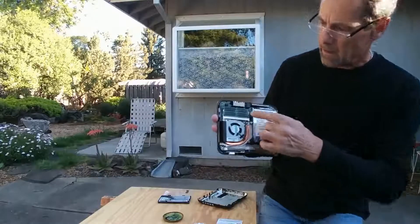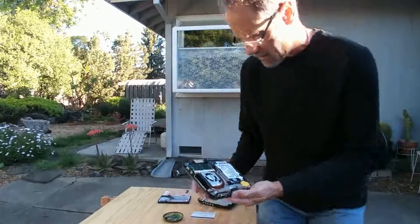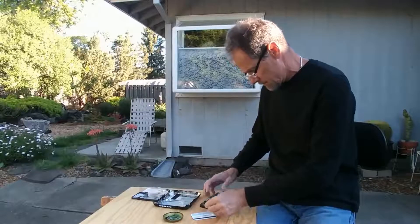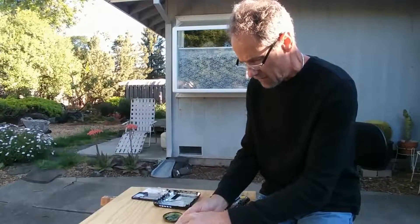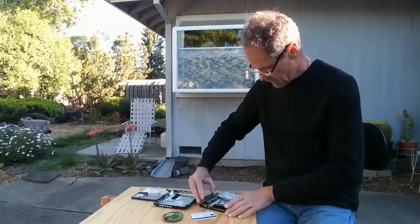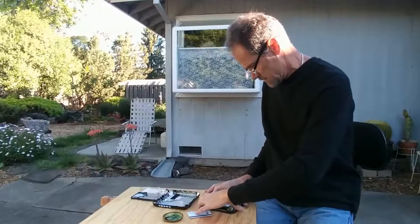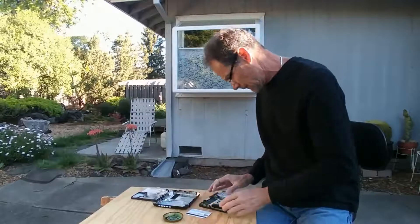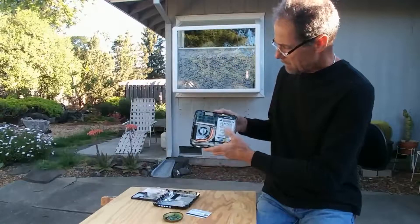And there's the card I'm going to replace, right there. There are two little clips to pull to the side and the card comes right out. We're going to take the new card, put it in the same direction. We're going to keep our fingers off all those contacts — we don't need greasy fingers on there. Snap it all the way in. New card's in place.